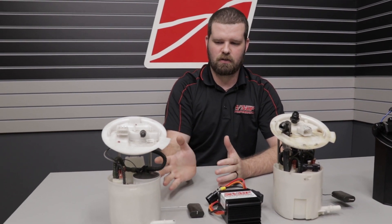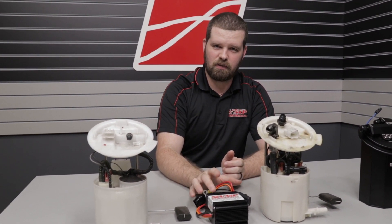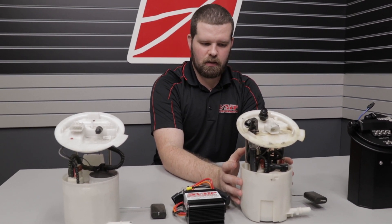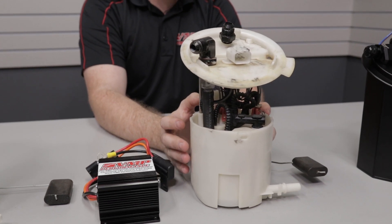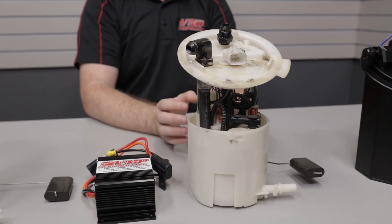The next logical step, once you max that out — which will usually occur around 750 horsepower — you'll start getting a rapid decrease in fuel pressure again. I'd say this is like the middle-level solution. Depending on what your goals are, this may not be the right solution for you, but this is what seems to come up most often.